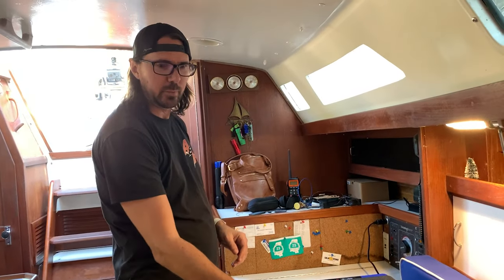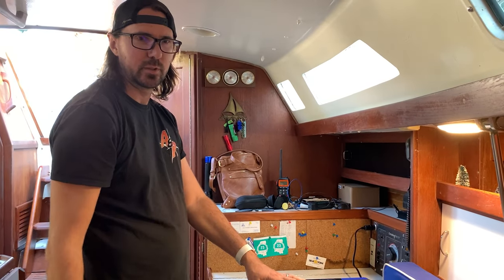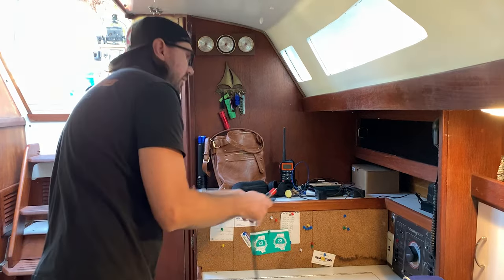It fits pretty well right here on the settee. I'm sure we could find a way to secure it so it can't flip off the side. We have 300 watts of solar run through a 20-amp charge controller onto four golf cart deep cycle batteries, and that should be plenty to run this cooler overnight and then some with plenty of reserve. We just noticed that when the voltage dips below 11 volts DC, the cooler automatically shuts off to save your batteries, which is a pretty cool feature.